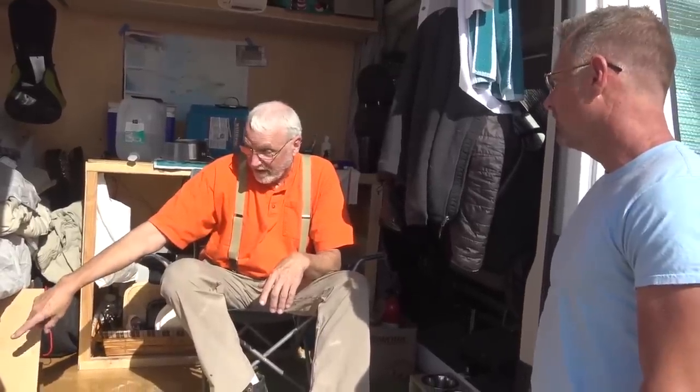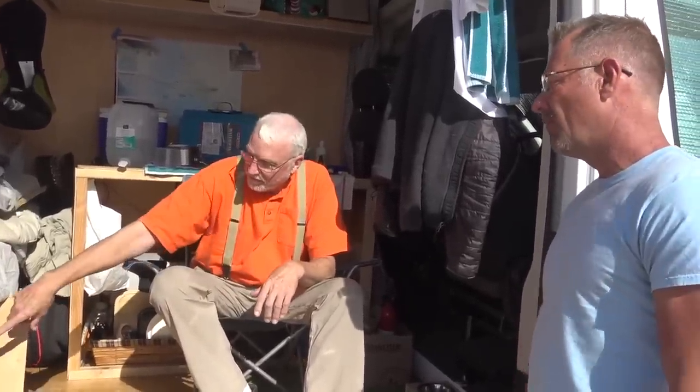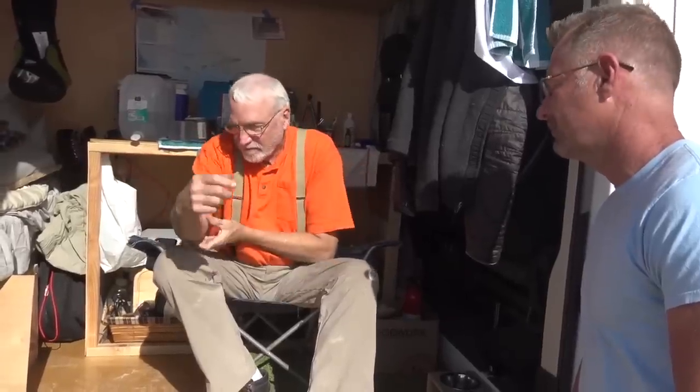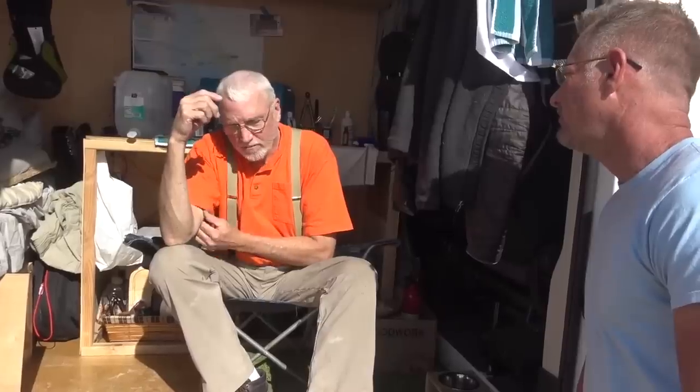What are these batteries? Are they 12 or 6 volts? Those are 12 volts. They're 215 amp hours at 12 volts, 5.5 inches wide, 12 inches high, 20 inches long. Why not go with 6 volts because of the thicker plates? Oh, you don't get thicker plates than that. If you get online and look up Odyssey PC1800 FT, you'll see pictures of yachts with 40 of those things in a line. They're meant for extreme applications, obviously in a yacht that's constantly banging things and stuff.